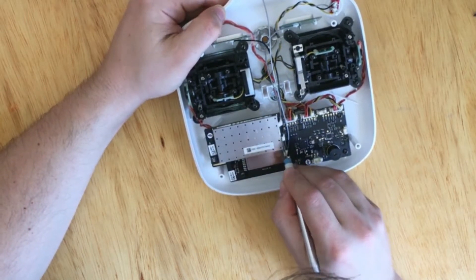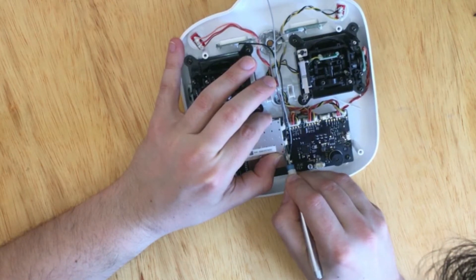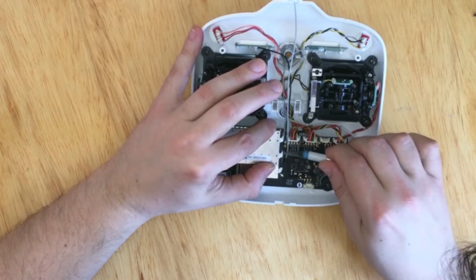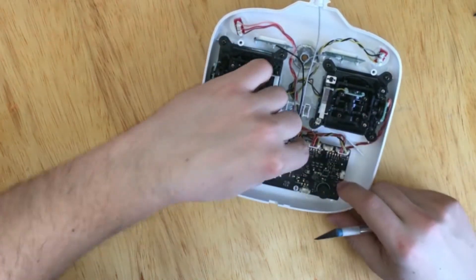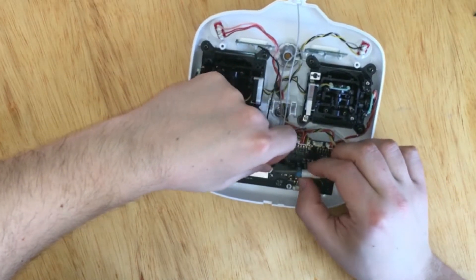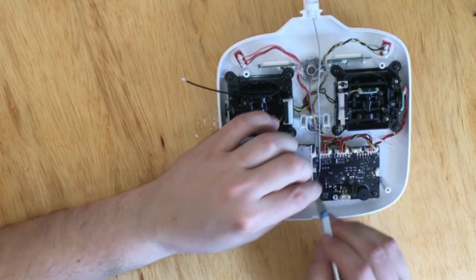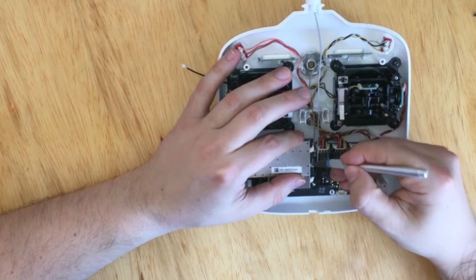What I'm doing is cutting the silicone glue that holds the connection in place. I'm going as close as possible to the aluminum shield, cutting the silicone and gently prying it. If it doesn't want to come out, I cut a little bit more and eventually it'll come out. Then I do the same thing with the top one and the bottom one, cleaning around the connection and removing as much silicone as I can from the previous glue.